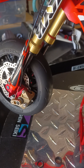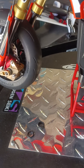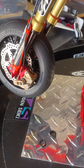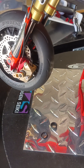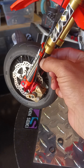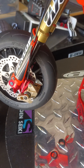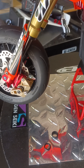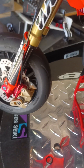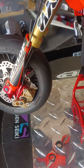It's going to keep all the dirt and grunge from going up into your shock tube and it's just going to be much more efficient. With the original ring, you get so much junk shoved up into it when you're running in dirt, mud, grass — it just binds the whole process of the shock. The other thing the o-ring is good for is when you hit the front end and have a crash — on the release it gives a little cushion on the inside so you don't bend the front fork. The o-ring will protect the shock shaft and how it bounces back. I put one in on each side and my suspension is so cushy it's unbelievable.